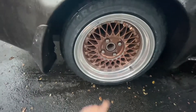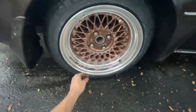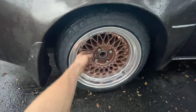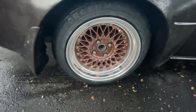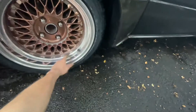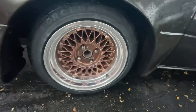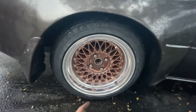The wheels look awesome but they're already dusty. This caliper is sticking really bad — when I had the wheel off, the outside pad had basically no pad life left at all, while the inside is like brand new. Same with the other side. I already have new rotors and pads for the rear.